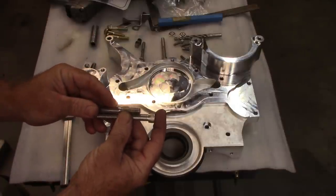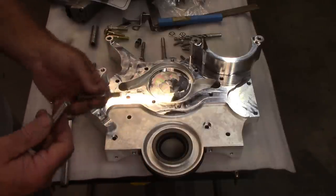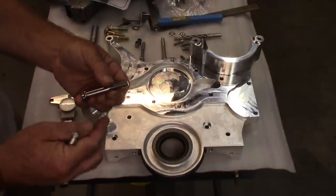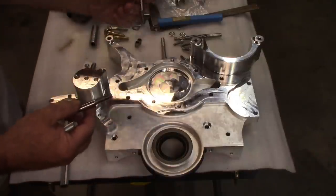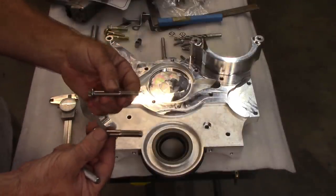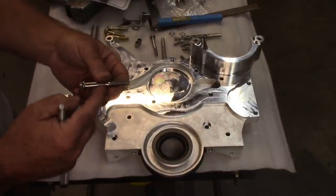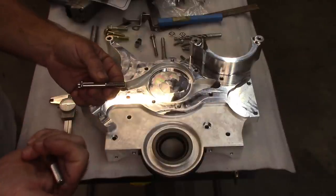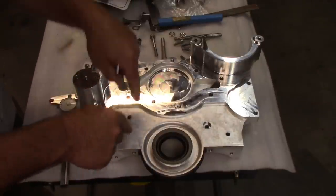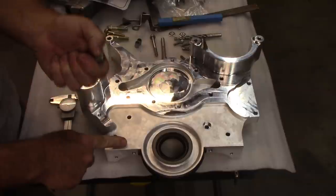These are actually 3, which lends me to give a demonstration as to what I want to show you. I'm going to take this bolt, which is the standard bolt that would normally work for this situation. As a comparison, this 5/16 is 2.5 inches long, this 3/8 is 2.5 inches long, but I only have one of these, so I can use it as a reference, thread it into the block, and do another drop measurement, because I don't want to be torquing this into place and the threads bottom out in the block and I don't know it.